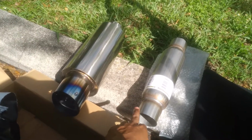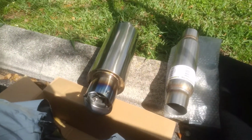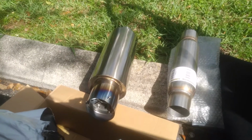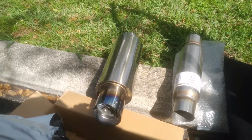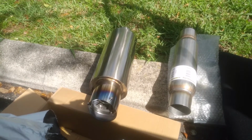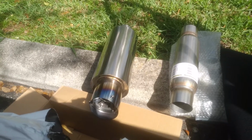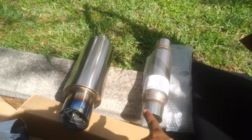It's a resonator. This is 3-inch both ways, 3-inch over there, 4-inch out right here. So I'm gonna do a 3-inch. I'm gonna run the 3-inch muffler from the header all the way until the back right here. But I'm gonna do this on the next video. Today I'm gonna install this right here.